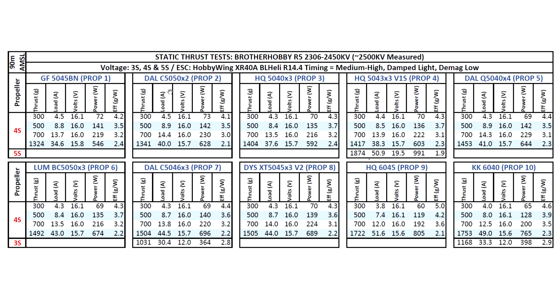The next prop was the 5050 by 2, the Cyclone. I ordered it to see how it does and compare it to the 5045 Gemfan. As you can see, it's slightly more thrust, but at a very high cost in amps — quite a lot more amps for very little extra thrust. This is on static, so it doesn't look that good here. But in the air, the high pitch might come into its own — at high RPMs it's able to grab more air, so it may outperform the 5045 in the air. The 5045 is holding its own right here though.